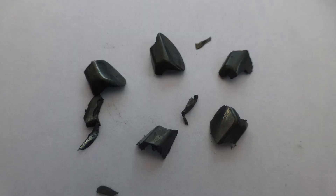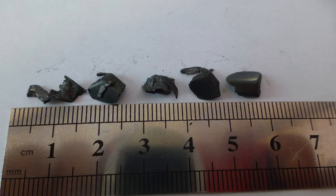This fine debris is generally a normal by-product of regular gear and bearing wear. However, if the quantity of metallic debris increases, or you notice larger or sharp metallic particles — like this Leaf owner found when they did theirs — it can signal abnormal wear or damage inside the gearbox, such as worn gears, failing bearings, or other internal component issues. So some discolouration is expected and is not an immediate cause for concern, and indicates that the oil is picking up contaminants from normal gearbox operation.